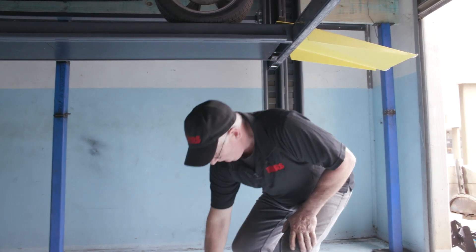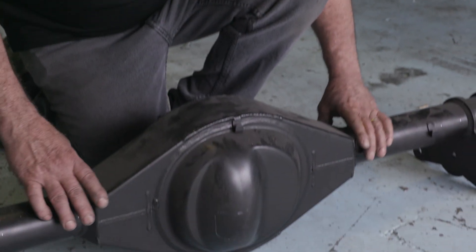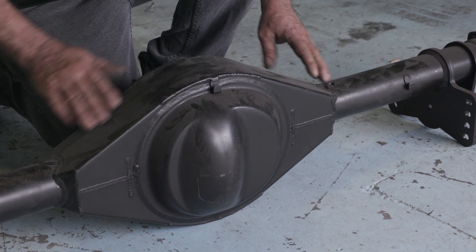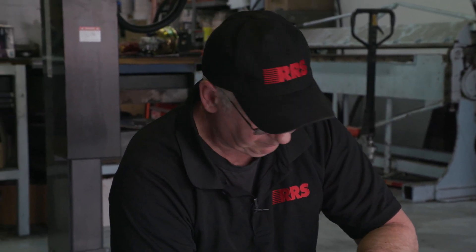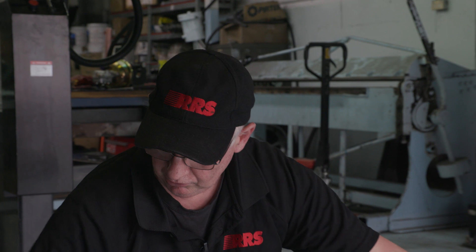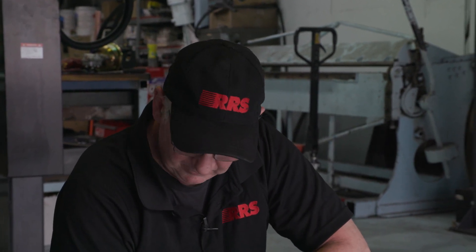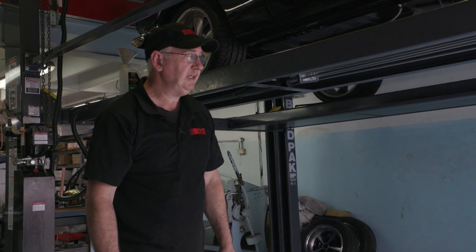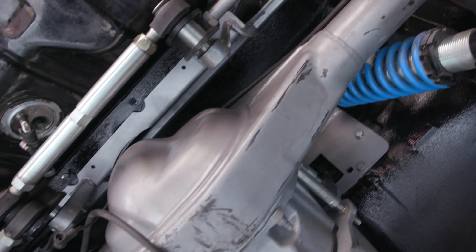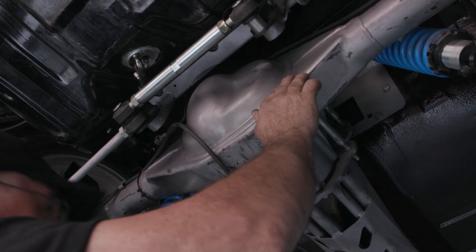This is an HRP housing and you can see it's got a lot of reinforcement in this area. All of these components, if you're not very careful, can cause clearance issues because this is a much larger housing. This one we've rated to up to 2000 horsepower. The one that's in my Maverick here is rated to 1200 horsepower, which is more than enough for such a lightweight car — with all the right axle bearing loadings and using the right axles, diff center, and so on, you end up with a bulletproof system. The housing in the Maverick is slightly lighter by eight pounds.